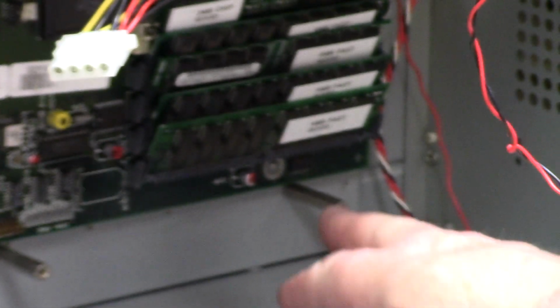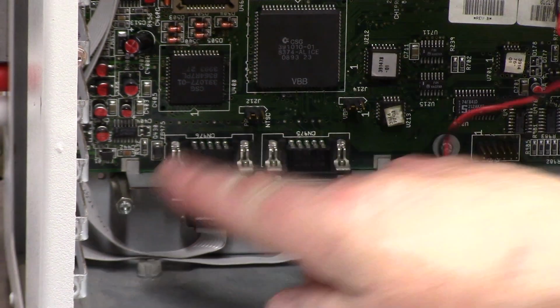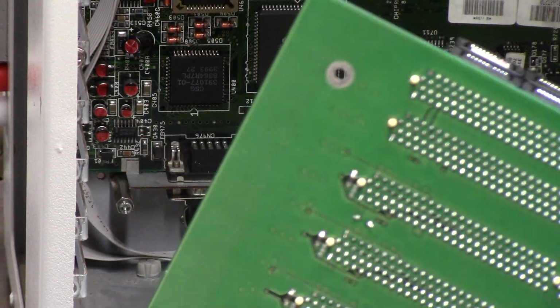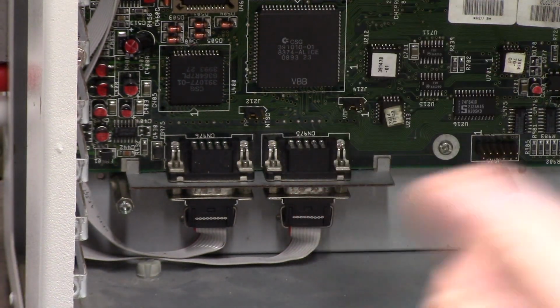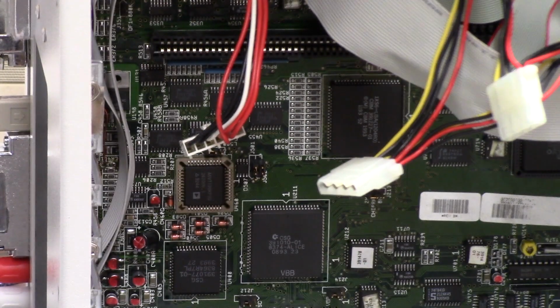They're these long pegs. There's 3 of them. Either this case is tweaked or something is, I don't know. On this one right here, I stuck a screw in it, all the way flat, and that touches the back of that ground plane. Doesn't hurt a thing because it's all metal. And that allows this to stick out just enough to compensate for the case torque. And it works. Now, right here is my socketed video DAC.